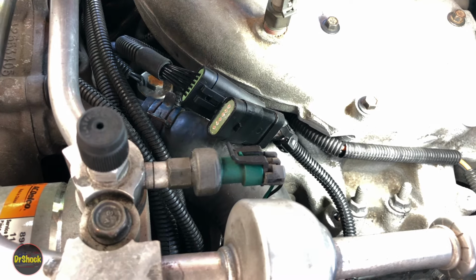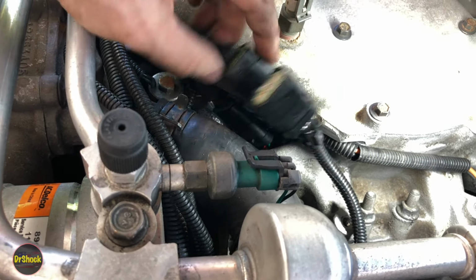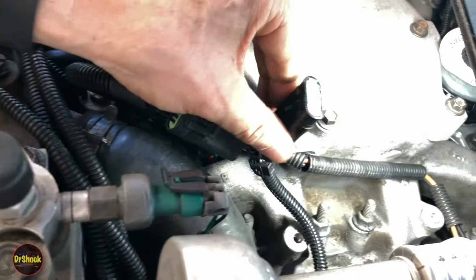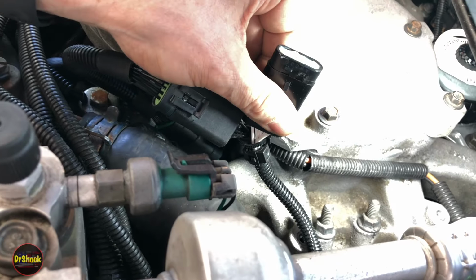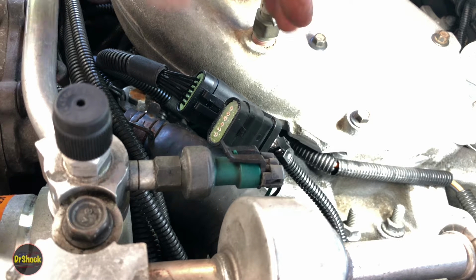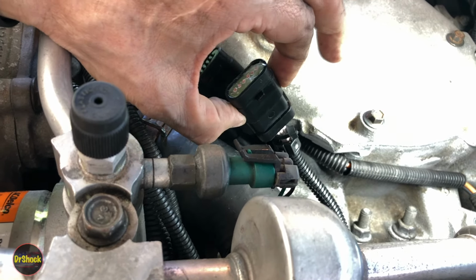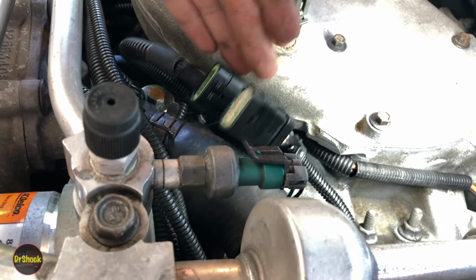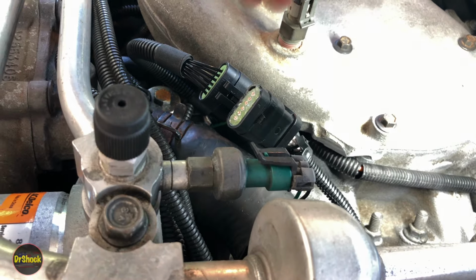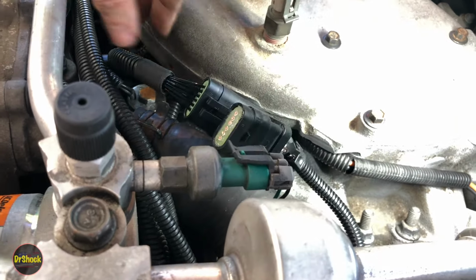No problemo. If the pump runs out its natural life and dies after the warranty, we unplug the connector here, and then you can see we've got a dummy connector. This is just an old connector that's been cut off an old harness to keep dirt and crud out of the extension harness connector. We just swap these two. We put the dummy one on here, and we put the live one onto the extension, and then we're going to pick up and start running with the one in the bumper. We just leave the one up here dead on the pump when it reaches that point in its life. At that point, we just go through a normal cycle of swapping out the one in the bumper whenever it fails, and we'll keep a spare for that too.